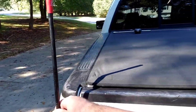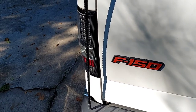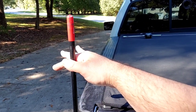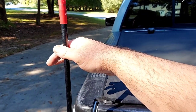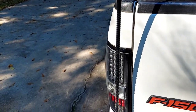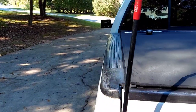This is one of the mistakes I see Jeep guys making — mounting to the bumper or to a spare tire mount, but using a very short antenna where only a little bit is sticking up above the vehicle. You're not hearing and not talking to the full potential of your CB system. So get the coil up above. I'm not saying you have to have an eight-foot antenna, but you get the point.